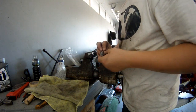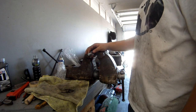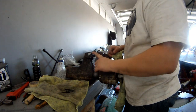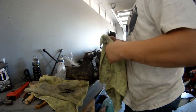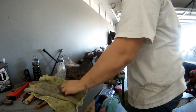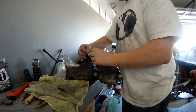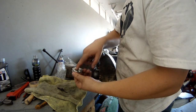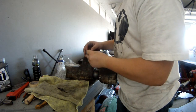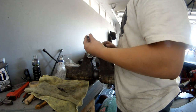The ones I'm replacing with are right here. This washer is only on the compression stack on this shock. I do have a replacement shock from FOA that has these washers on both the rebound and compression sides. Now I'm going to put the shim stack on — the wide base goes against the piston. Remember that the two flat holes go against the compression stack. On the rebound side, the flat side also goes against the piston. On this shock there's no thick washer, so just the nut goes up.